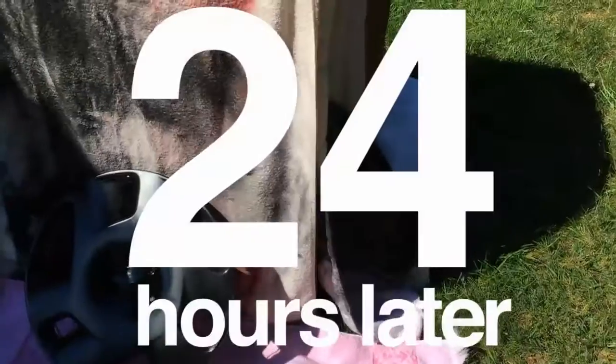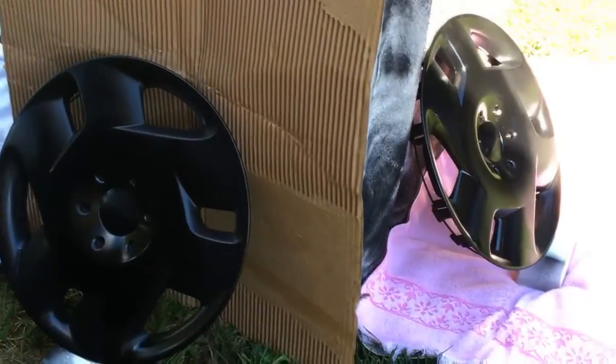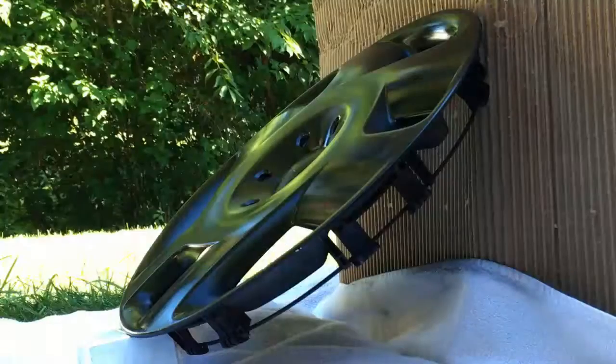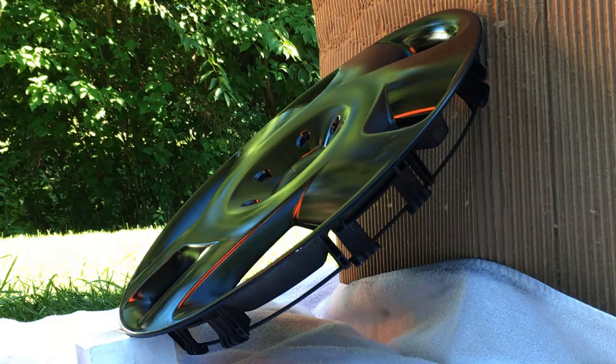Day two — 24 hours later — about to apply some clear coat acrylic enamel crystal clear. I've set the hubcaps up differently this time, spraying them upright as opposed to flat on the ground. I felt my spray wasn't as consistent shooting straight down, so I'm pointing them up like this. When I do clear coat I apply it a little thicker than my color coats.